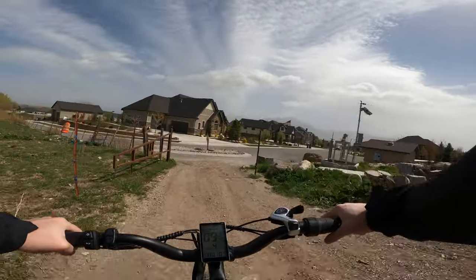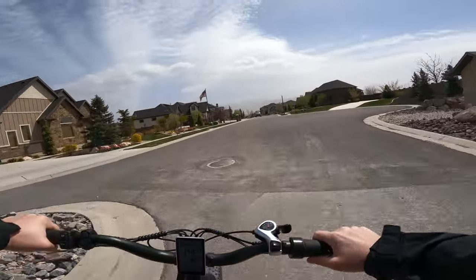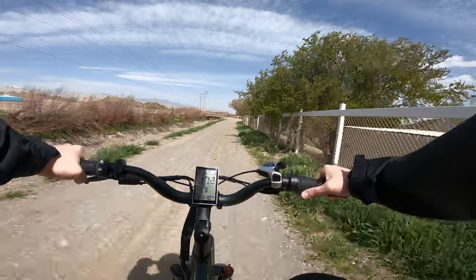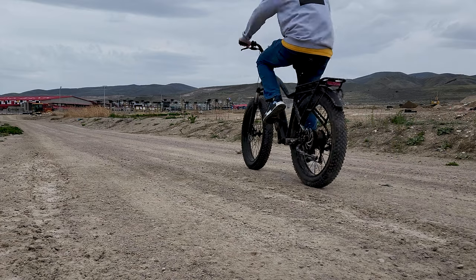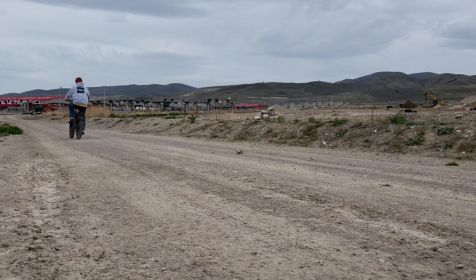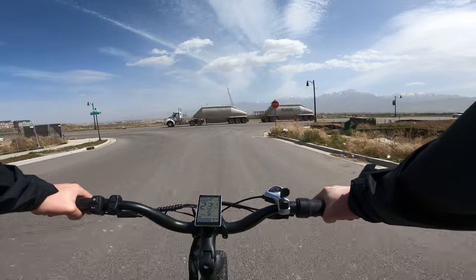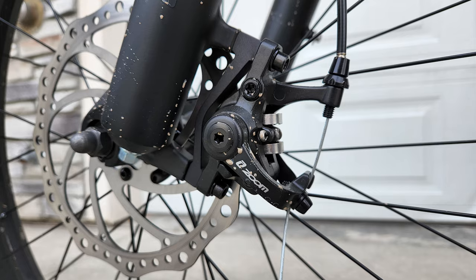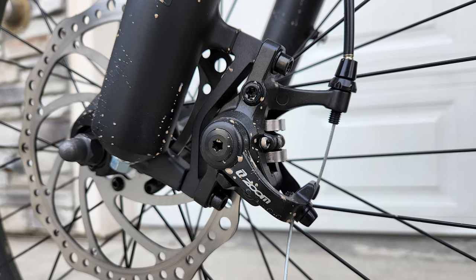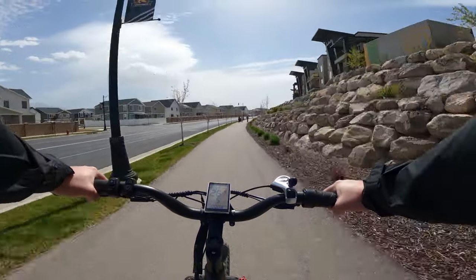The size and weight of this bike makes it feel a bit awkward and jangly on chunkier terrain. It is really well-suited for more mild dirt roads, with the tires offering plenty of traction and allowing it to maintain almost the same speeds as it would on a paved road. The brakes are, quite honestly, mediocre, just barely offering enough stopping power for this bike. These really should be hydraulic disc brakes rather than mechanical, given the speeds this bike is capable of and its 80-pound weight.